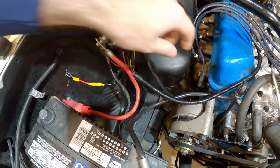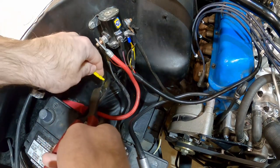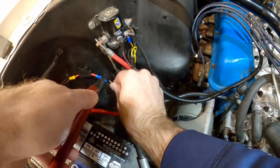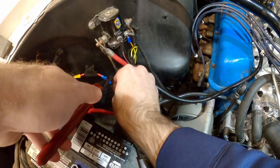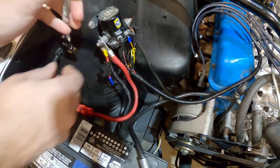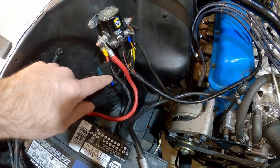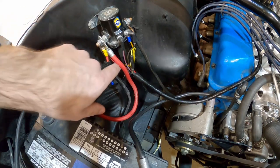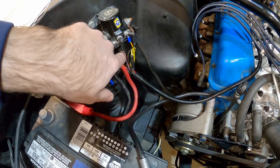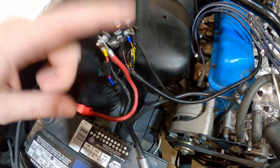Now that we've got the wire loom covered on the old wiring, I need to come back and put an inline fuse on this wire. We're just going to cut it here and crimp on this new inline fuse. So now this is all wired up — we've got the 12-volt source that is only triggered by the relay, so it's not constantly feeding the coil on the electronic choke. It's only triggered when the relay is triggered, and this terminal here is going to trigger that relay. Let's check the terminal on the electronic choke and make sure it's working.